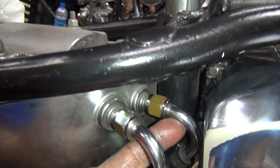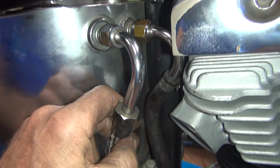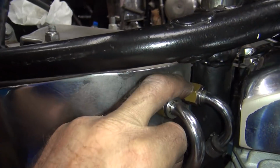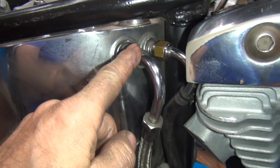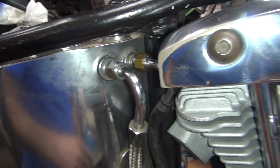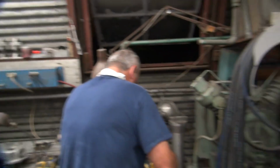I got this one tightened up and I had access to it. Hey, it's going to shoot my way. So we're trying to keep it off the motor, away from the exhaust system and the rubber hose. We're going to flow the oil, the return oil is on the inside instead of the outside because it goes right down here to come back out. So coming from here to here doesn't let anything work on the other side. So at least cross it over. That's called a crossover design.